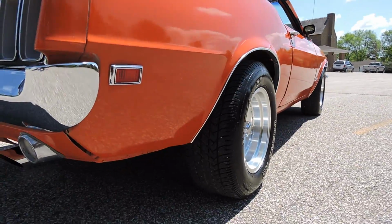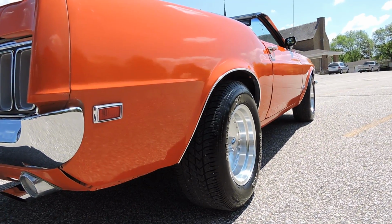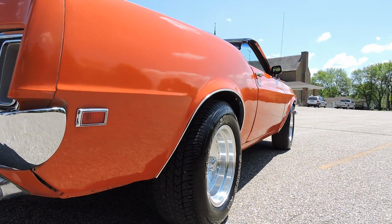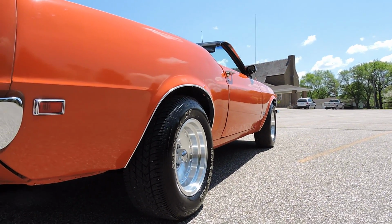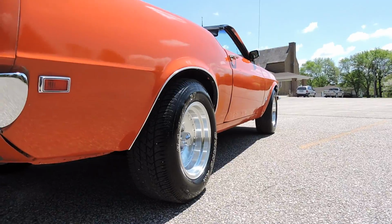As we look up and down the sides, passenger side door, there's maybe one or two little ones on the quarter. Like I said, it's just got a little choppiness, like little tiny door dings that weren't quite blocked out right, especially on the doors. Looks like both doors are kind of the worst. If a guy blocked them and smoothed them a little better, it'd have been a lot nicer job.